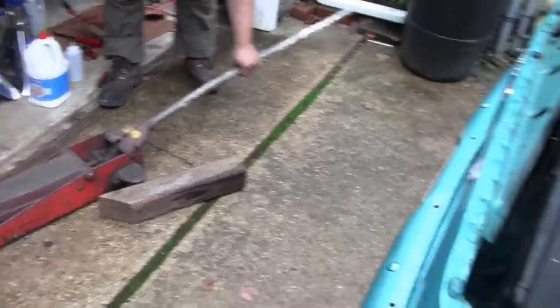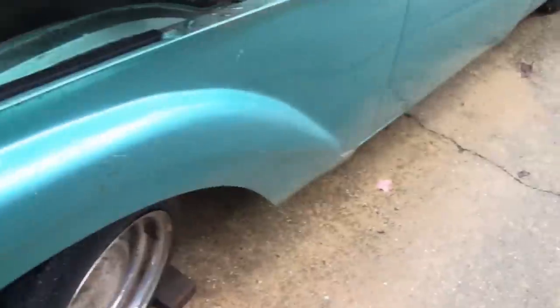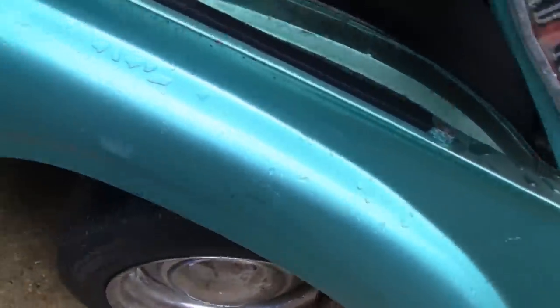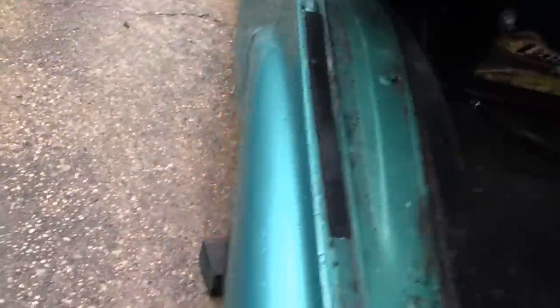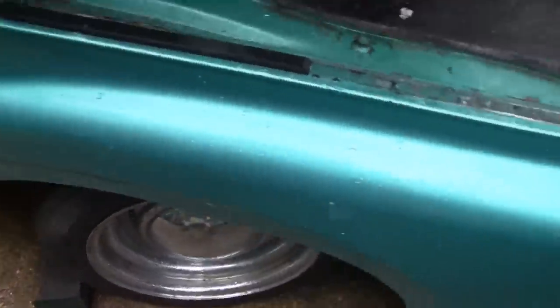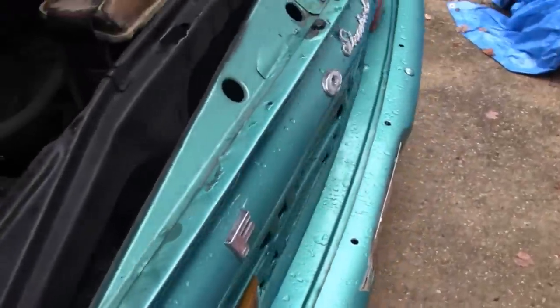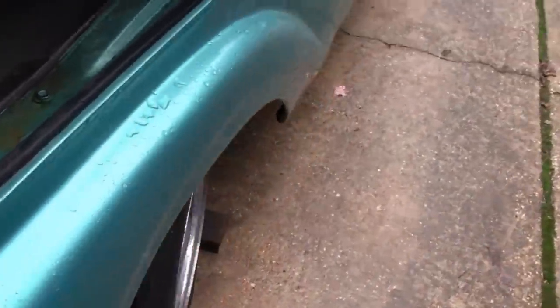I even had it rebuilt back then. What we're gonna do is, whoever had this truck, they lowered it. They took the axle and took some leaf springs and put them on the top, and the thing's just about riding on the axle. It's gonna need brakes and cylinders and stuff like that, so I decided to just change the whole front end over, and it needed kingpins. So me and Mike are gonna take this out now.